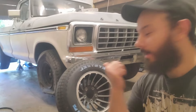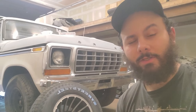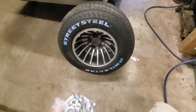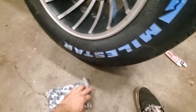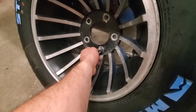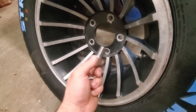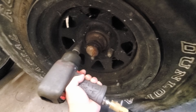The two-tone truck is back in here. I got new wheels and tires for it and I bought new lug nuts because it takes the fancy mag lug. Here are the brand new lug nuts for the mags — they're one inch. The way to tell is the distance of the material here, so when it pokes through it doesn't go all the way through. It also comes with washers to take up a little extra space so it'll be more recessed. This is exactly what you want with these kinds of wheels — they take up most of that depth. Let's get started and put on this beauty.